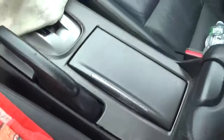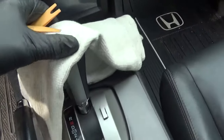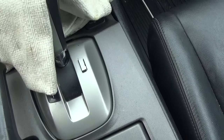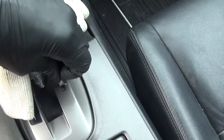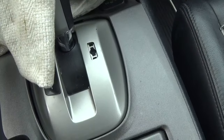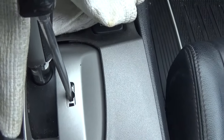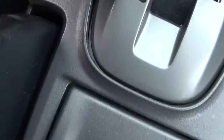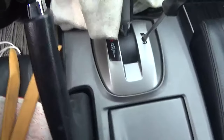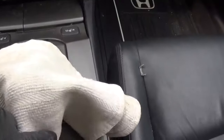I've covered up the leather seats — I don't want to risk damage — and I've got a cover for the shifter knob. A nice little trick I learned is you can pop this little piece out of the shifter, and then with a screwdriver you can release the shift lever without turning the car on. I can just press down with a screwdriver, and after putting on the emergency brake, I can release the shift lever. That makes working on all of this stuff up here a lot easier.